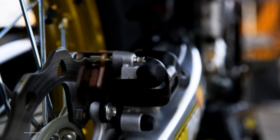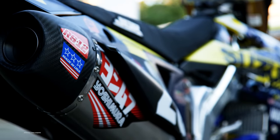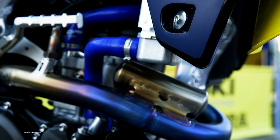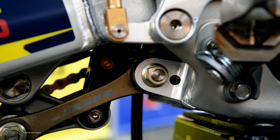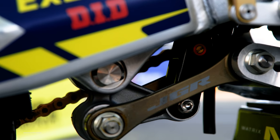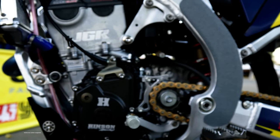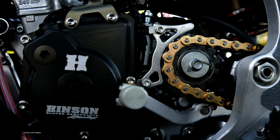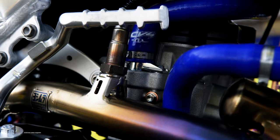The muffler is the latest edition — RS-12, the newest one. For the header pipe, we use the chamber on it; seems to work a little bit better for our motor. The pull rod is made at JGR and has a removable pill so you can change the length — easier than making all different pull rods. We just change the pill to lengthen or shorten it. All hardware is titanium and aluminum other than the axles, coming from Suzuki Japan. The header has an O2 sensor for data.